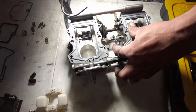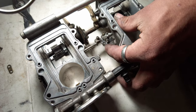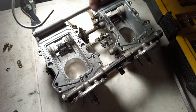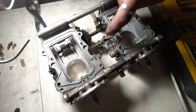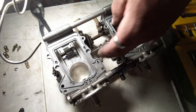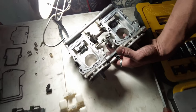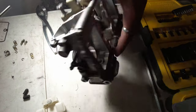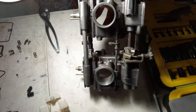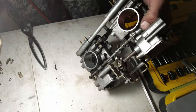This is where the choke cable goes onto the carburetor. It was sitting about parallel with this choke pin at the resting place — just so I don't forget that, that's where it sits. This is going to swing around when I pull that pin out. Once you take it apart, you have no idea where it was.